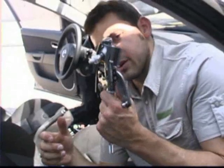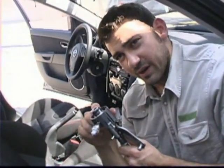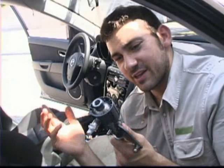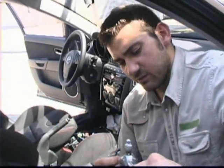All right, so once you pull the shifter out, you're going to have to reclaim this cup and this O-ring. Now, some of the kits might actually come with an O-ring. If you are one of those people that has one, you're lucky. So, boom, cup comes off, and we'll put this aside and pull the O-ring later.